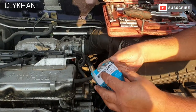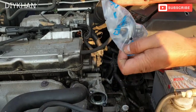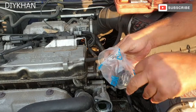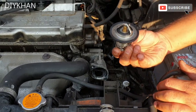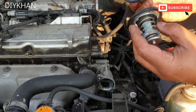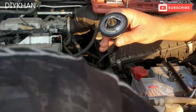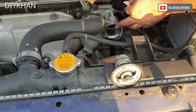This is the new thermostat — we got this from your car parts for $6.99. You can see that the old one is seized; see the pin? The old one is faulty, so that's why we're putting in the new one.